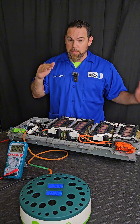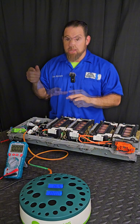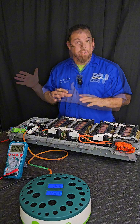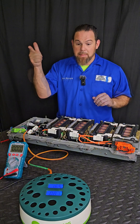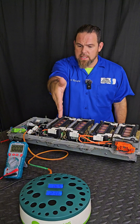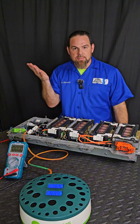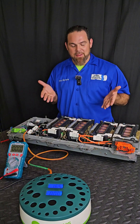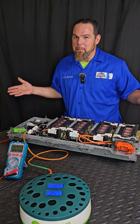Can these batteries be overcharged? Yes — so you must be very careful, because overcharging can also generate diagnostic trouble codes and prevent the vehicle from starting. Always work within the vehicle's specified parameters. To summarize: yes, you can charge a lithium battery collectively using a low-current high-voltage charger with no problem. Once this battery reaches 210 volts, it's ready to reinstall. Like and subscribe — that's how you help us provide more content about hybrid and electric vehicles.